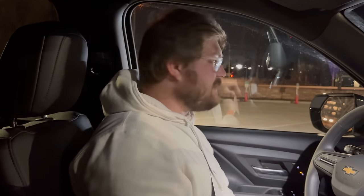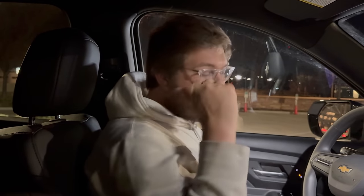Now it was a colder day, yes, and we maybe did a little bit less stopping, but I would say the driving style was about the same. A couple of wide open hits here and there, just like we did. And I think one of the reasons this consumed so much more energy again was that the trailer brakes were constantly activated. And so we probably burned a lot of kinetic energy as heat loss in the trailer brakes rather than as regen in the vehicle.